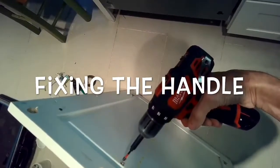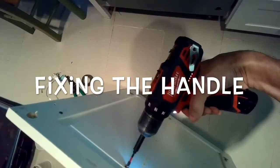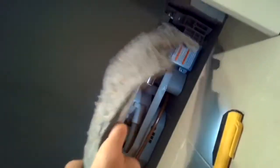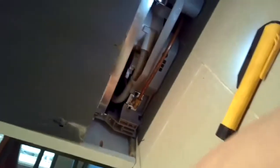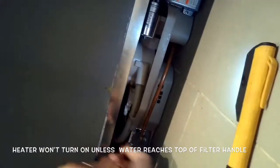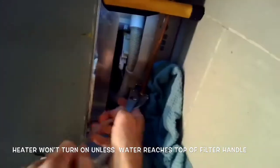I've removed the front panel by removing two screws on the back and then lifting it off. I'm also fixing the handle that was loose. I'm going to make sure I turn off the water supply and unplug the machine. Then I'll replace the valve. I removed the bottom kick panel, removed the insulation, and I'm going to loosen the water supply coming into the inlet valve.